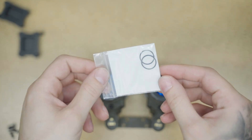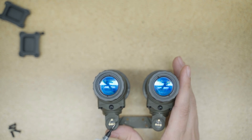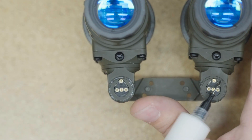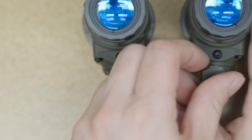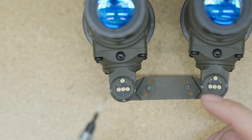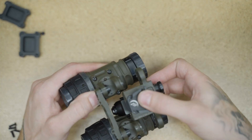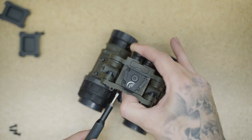So we are going to now open up the packet with the O-rings. And we're going to take some lubricant and just put a small bead in the channel. I always recommend just throwing a couple little drops on the outer surface. But once that's all done, you just sandwich everything together and then screw everything together.